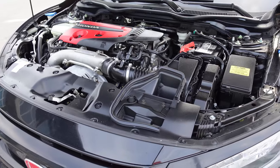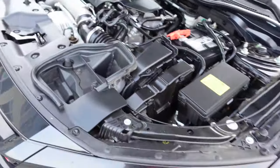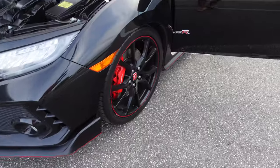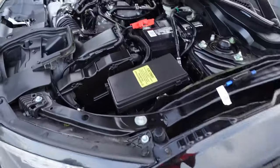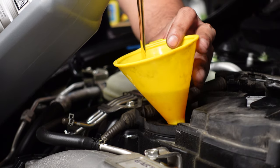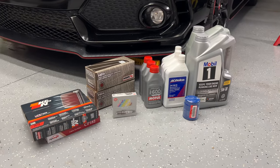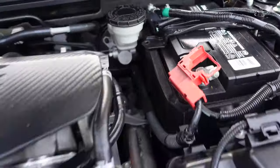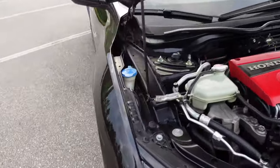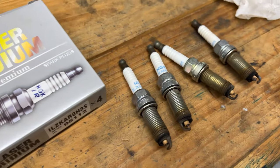Make it so that you can take it to the track and have no issues. A couple of things I'm going to do first — probably wheels and tires first. We're going to test these stock tires at the track and then compare them to new wheels and tires to see what the difference is. But obviously I'm going to do all the maintenance before I take it to the track: all the fluid changes, brake pad check, bleed the brake fluid — that's the most important thing. Make sure the battery is tied down, which right now it's kind of loose. It's over 100,000 miles, so I'll probably do things like spark plugs, but nothing major.